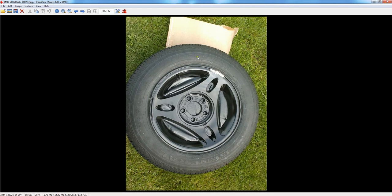The easiest way to get the paint off the rubber that I found was the same stuff you use to shine your tires — tire shine. You can use different kinds: black shine, foam spray, whatever you've got. Even the foam stuff will work. Spray it on the rubber, making sure the paint is dry on the rims themselves. Then take a dry, clean rag or cloth and wipe it off. The paint will come right off the tire rubber without a problem — it'll stay on the rim but lift right off the rubber. Spray or foam it again, let it dry, and the tire will be nice and shiny with all the paint removed.